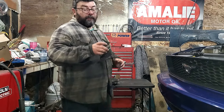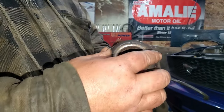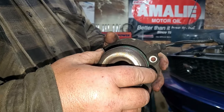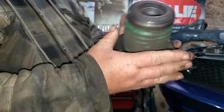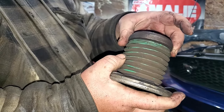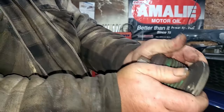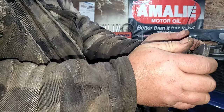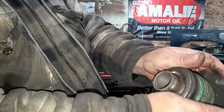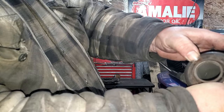But these are consumable items. And you can see here where this release bearing is worn and it's getting sticky. Your release bearing here shouldn't have that much side-to-side deflection on it. When you're pushing on the clutch and there's some side-to-side deflection, it causes that to stick — it's just hanging up.